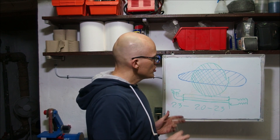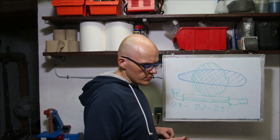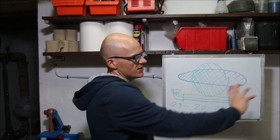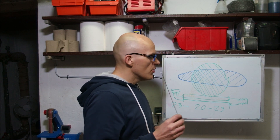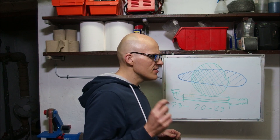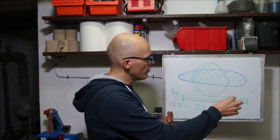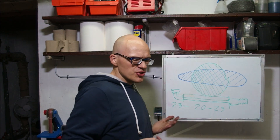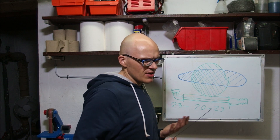So now let's discuss aerodynamics. Traditionally, spokes are round because they were formed from round wire. However, some manufacturers create spokes which are flattened along their length, which provides certain aerodynamic benefits. What's important about them is that a spoke is going to perform identically in terms of the mechanicals of a wheel if the area of its cross section is the same, regardless of the shape of that area. Which means that an aerodynamic spoke formed by flattening round wire performs just like a round wire spoke of the same cross section.